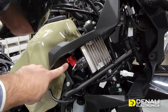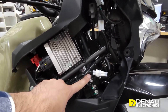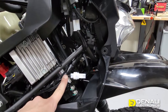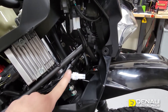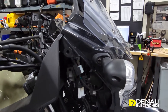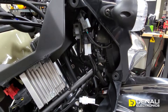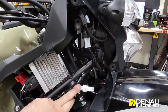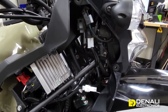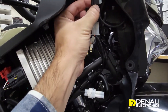That red six pin connector is actually your diagnostic port, which is being standardized across a lot of motorcycles going forward. You've also got your factory fog light connection — that's this white two pin — and that's providing power directly from the battery. Right up here is a relay socket for a small micro relay just like this. Kawasaki sells that for twenty dollars on their website, and that's how you activate the factory fog light circuit as well as the factory USB charging circuit. We also sell that same relay on our website for around ten dollars.